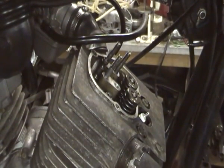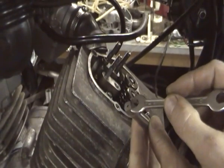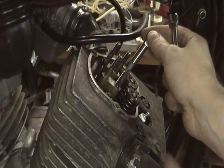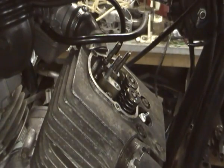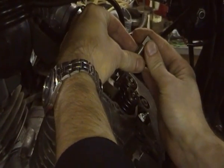The next part of the process is to use the oversized tap that comes with the threading kit. I don't really have room in here to use a conventional tap wrench, so I've got an open-ended spanner which is a decent fit on the end. You've got to keep the tap parallel to the stud in both axes. I'm going to coat the tap in some tapping compound which will both improve the cutting action and retain the swarf instead of it getting into the engine.